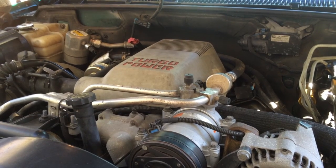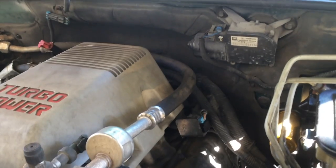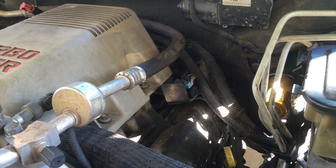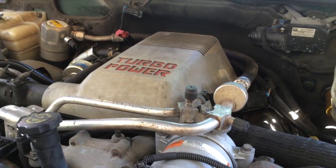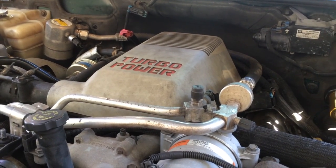It's quite common, and 9 times out of 10 it's going to be this little guy back here called a wastegate solenoid — you can see it towards the back with the blue connector. But to really see the whole flow of the circuit, we're going to need to remove the turbo power shroud housing off the intake manifold, and we're going to do that with a 10 millimeter socket.